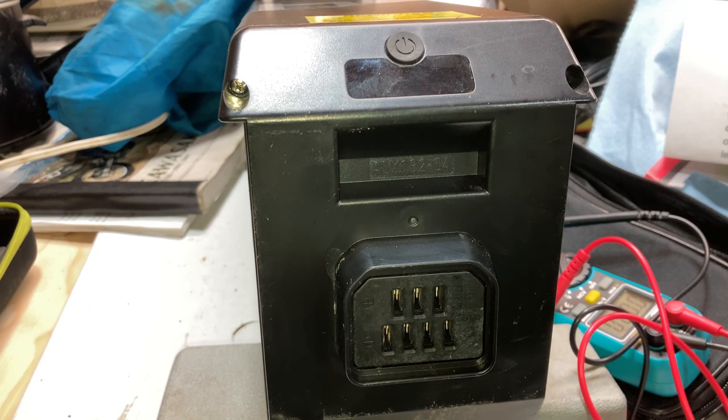In this video I'm going to show you how to check your percentage left on your battery by checking voltage. Most chargers when they charge a 48 volt battery it'll go up to about 54.6 volts and then it'll kind of steadily drop down to 53 once the charger's off.